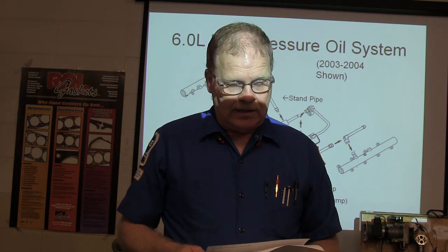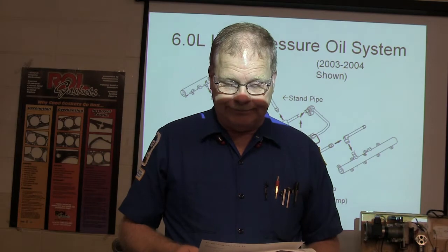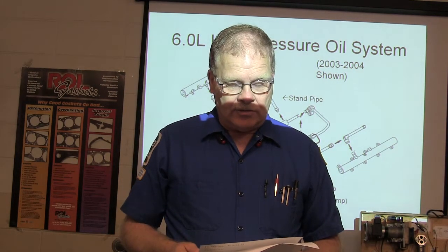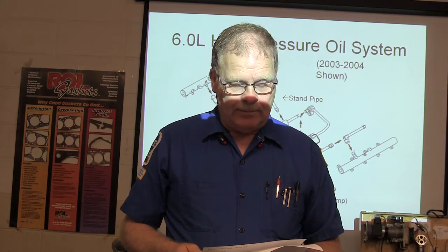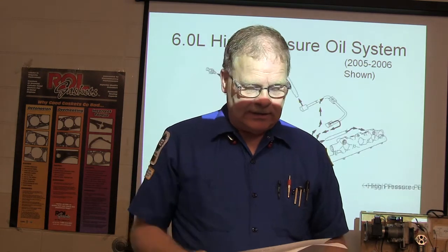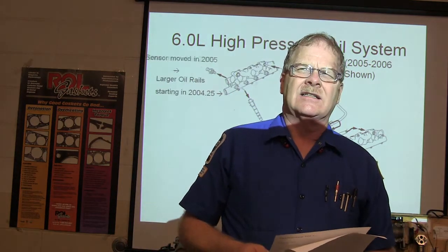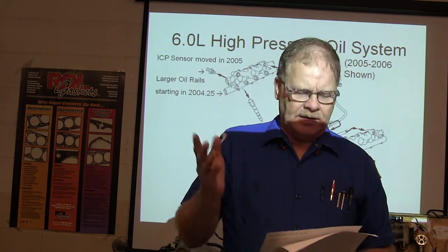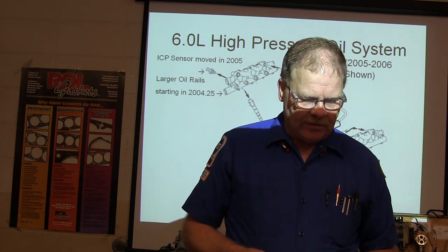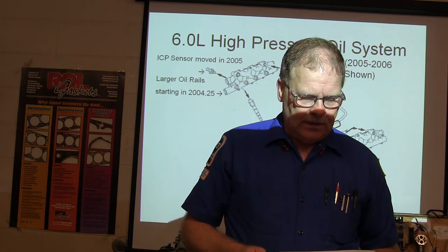Okay, where are we at? Which is the type of spring? All of them. All the above: torsion bar, leaf, coil. Most trucks and larger rear-wheel drive vehicles use which type of frame? Full frame. They use a full frame, which looks like a ladder, and it's got the rubber mounts on it. And that's why you'll see a lot of these guys, when they're doing engine work, they'll actually pick the truck up off the body. It's a whole lot easier to work on the engine when you got the thing picked up.